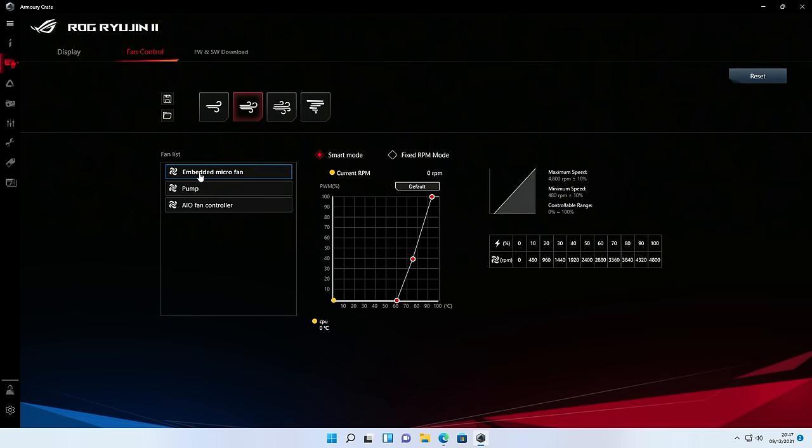So at the moment we have a fan that you've seen whenever I took the cover off the AIO, and we can see the fan curve that it's running on. It's quite a noisy fan, so it's better not to have it coming on until the CPU is heating up quite hot, and then it ramps up quite quickly, so that looks fine to me. The pump is running off this curve here, just the default curve again. I'm not going to adjust that for now.